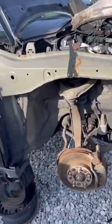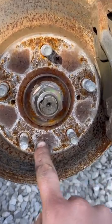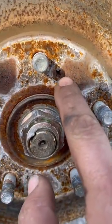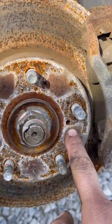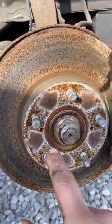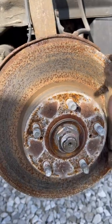Here we're talking brakes. If you notice this brake rotor on a Honda has two of these set screws — kind of rusty and crusty, two of them right here. Did you know what these holes are for? These are threaded holes, and when you have the caliper off you can dismantle the rotor from the hub simply by putting a bolt in either side and walking it off and popping it off.